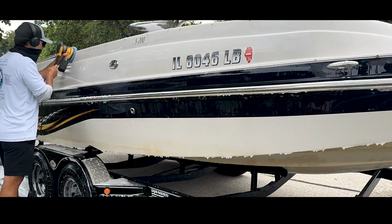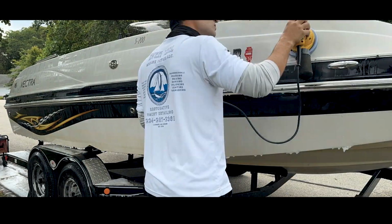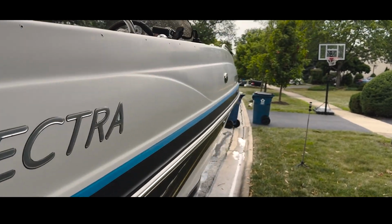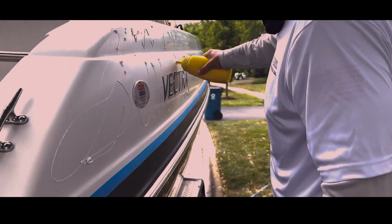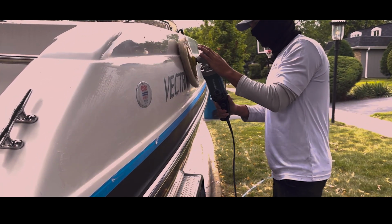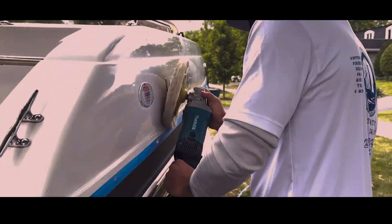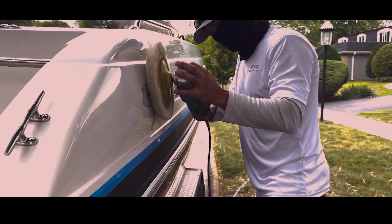Rather than using multiple passes of heavy cutting, you can expedite the process by a quick wet sand most of the time. Once I've washed and dried, we get a clean but milky surface. Heavy cutting. I want to use 2 passes. The first cut will be focusing on application and really grinding down at low speeds, 600 to 1000 RPM. I'll then brush off the pad, apply a lighter coat of Level R, and burn it up at higher speeds, 1000 to 1500 RPM.